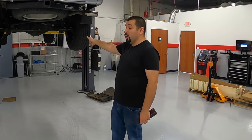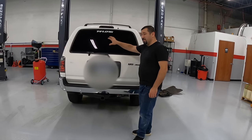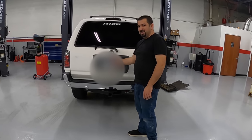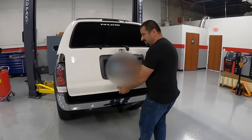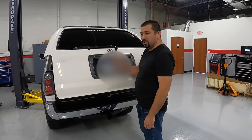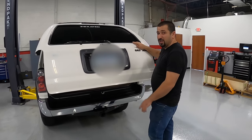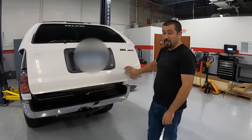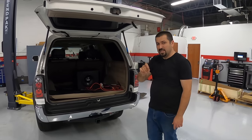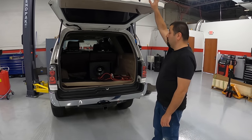Having said that, let's lower the car and look under the hood and inside. Since we're in the back, this window rolls down — a beautiful feature of the 4Runner. One thing I'll warn you: the handle is notorious to seize and cause issues, so be gentle because if it's seized and you pull hard, it'll snap the handle right off. Always be gentle with these. The window is also notorious for the run channels to get rusty — you lower it and it falls off the track. These are a little harder to check because you have to pull the panel and look inside. Test them when buying one because replacements can get expensive.